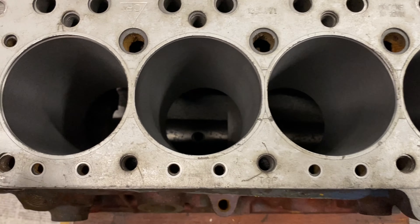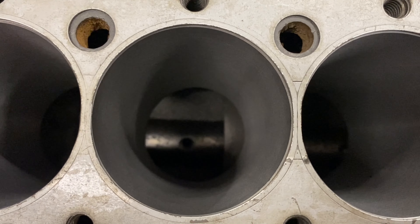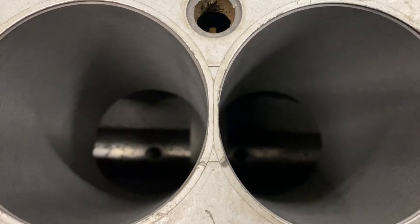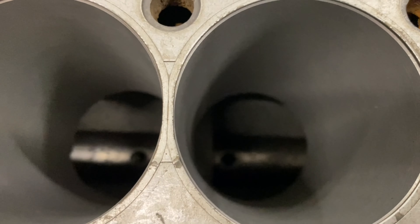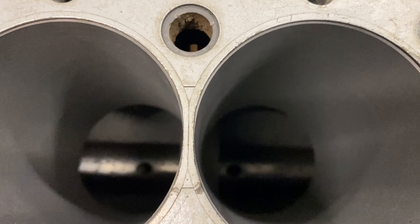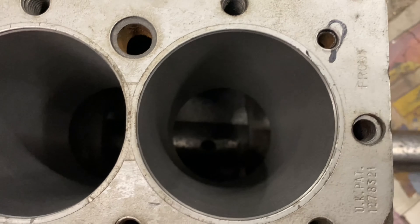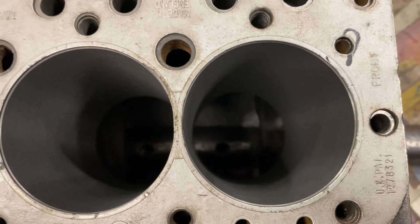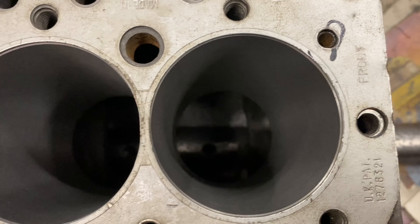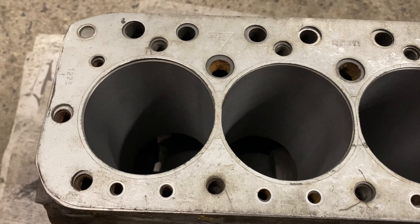How does our gasket look? If you have a look, the gasket fits over our holes nicely - all the threads. We look at cylinder number four, cylinder number three, and there's the all-important center. You can see the center of the gasket is nice and thin, but the center of the block has actually about the same witness width as the gasket. Cylinder number two, cylinder number one - and that's a 1380, so that all lines up just about as good as we can get it with this particular genuine original gasket.